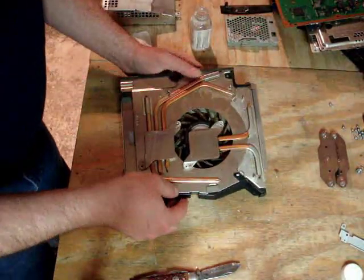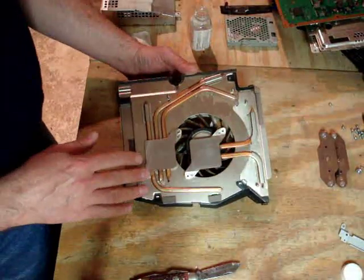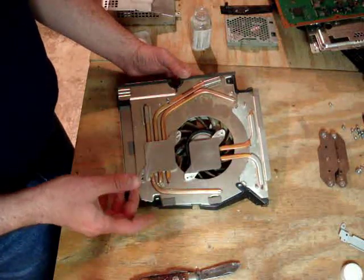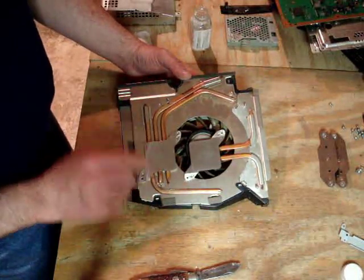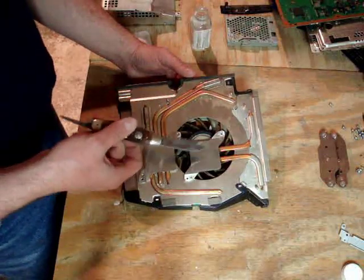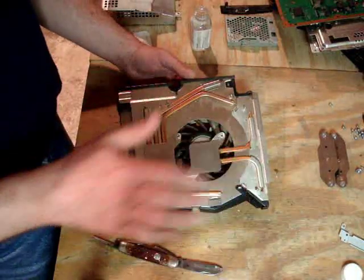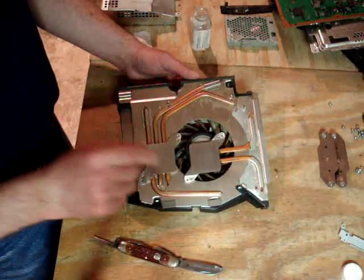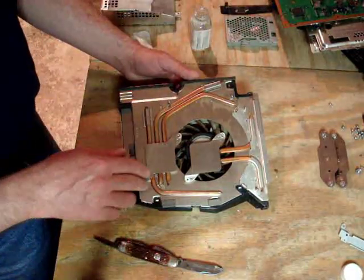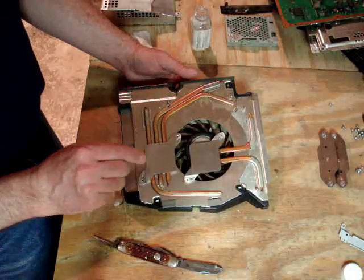And before we paste this, I'll just mention real quickly what's going on here is the fan obviously is pulling the heat away from the radiator, just like your car. Now, we've got the thermal paste spread on the blocks here in between. Well, we're actually going to put the thermal paste directly on the processors, but when you put them together, they're smushed like an Oreo cookie. You've got the one side of the cookie is the processor, the other side of the cookie is the block, and in between there is this very thin layer of thermal paste.